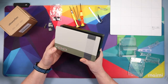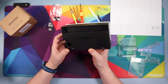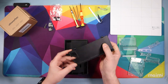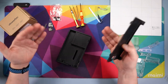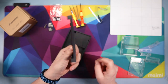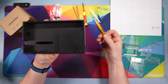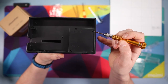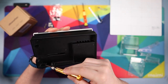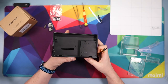This is my original dock — the one I did the faceplate mod on, used as my test dock. The first thing you're going to do is the back flap; I just find pinging it off makes life easier. If you're going to reverse this mod keep these bits to one side. Then grab your three-pronged screwdriver and do eight screws: four on one side and four on the other, eight in total. Get all eight out and put them to one side.